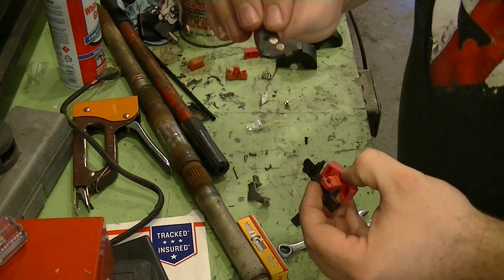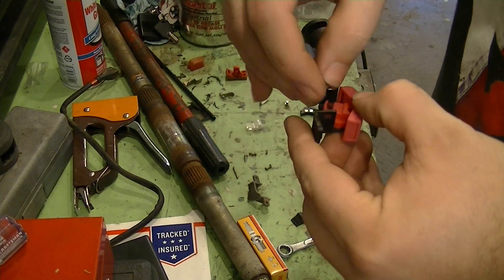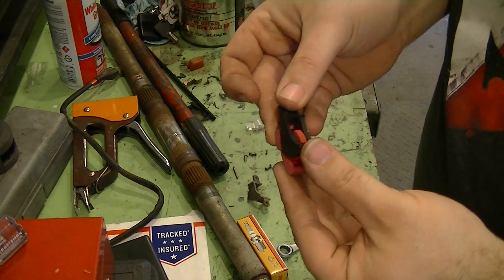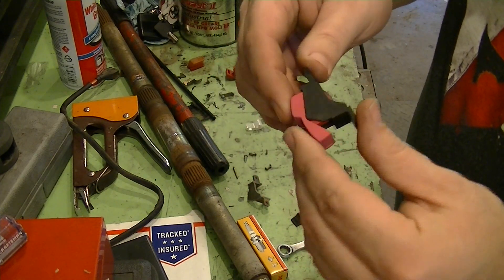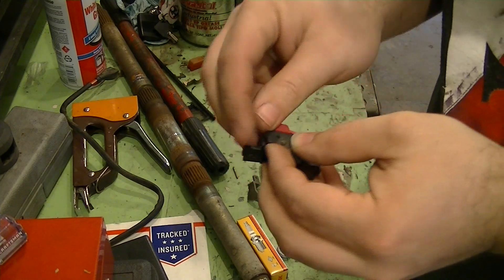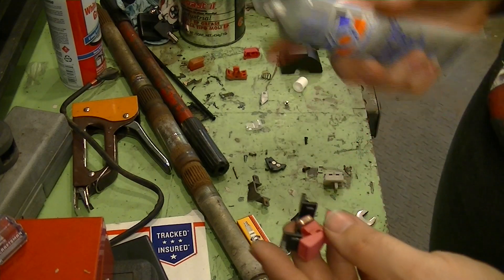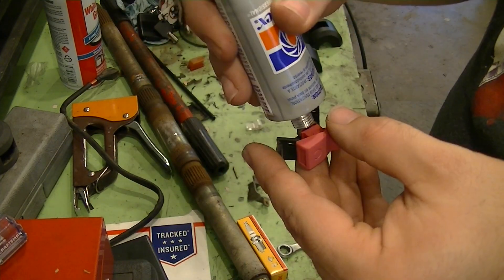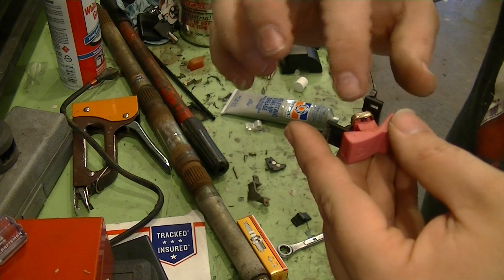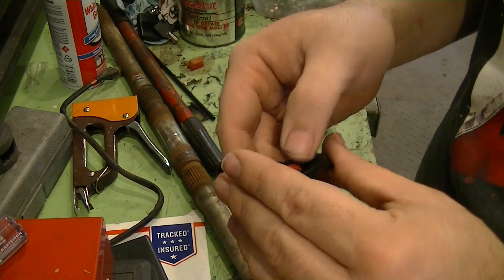Now we've got to put this side down, which is where the little metal strap comes in. In this case, I'll just bend it a little more square. It sits on here and then this clips down in place — there you go, you've got another switch. Before I completely reassemble this, let's get this back out because I'm going to put some dielectric grease on here. The dielectric grease acts as a lubricant and will keep moisture away, which means I won't have to worry about corrosion on my connectors. We'll clean that up nice, slide this back into position, and now I've got nice protected contacts.